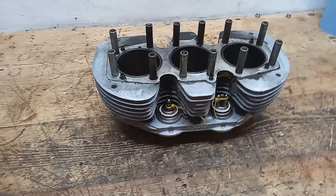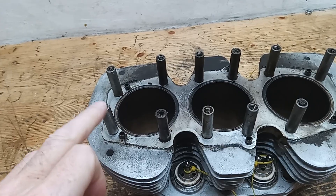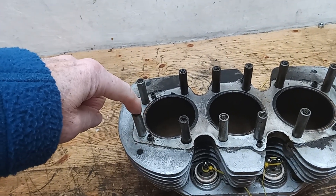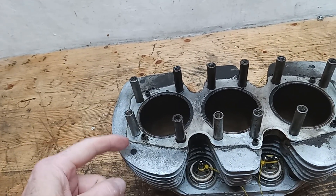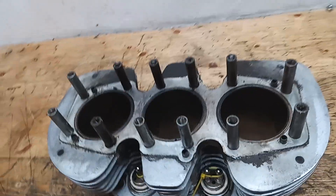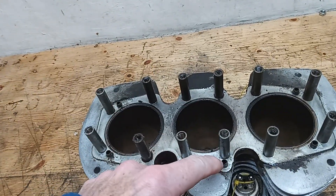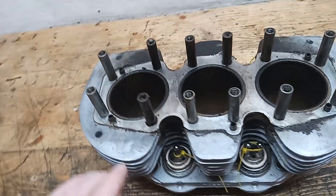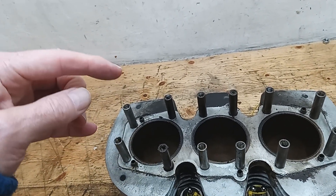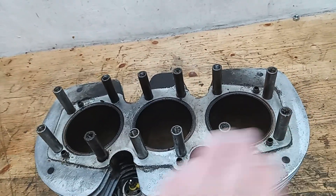Right, onto the barrels - just getting these ready to be taken down for blast cleaning. We've got the pillar studs here; the cylinder head studs screw into the pillar stud, and the pillar stud itself screws into the barrel. We're going to unscrew those and take them out. These little dowels here are for the oil ways - they come down through the head and through the barrels and drain back into the crankcase. They may need to come out later if we have to skim the head flat.